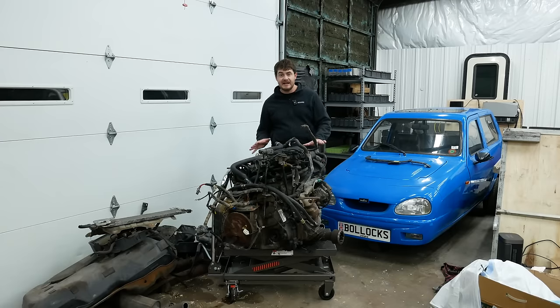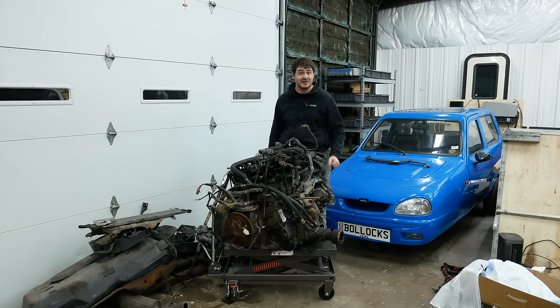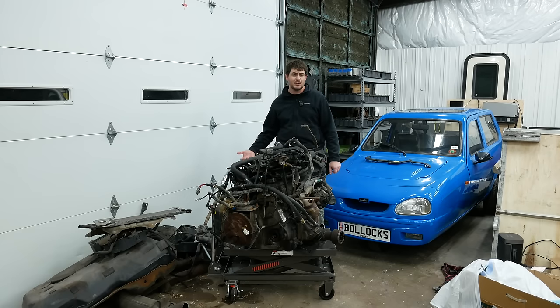I've been saying this thing has a blown head gasket, but I don't actually know that for sure. All I know for sure is it has an exhaust leak. We both know that because we both heard it. It has an oil leak, probably all over the engine. The bottom of this thing was just shimmering with oil. The alternator is absolutely caked up with oil. It has a coolant leak. The water pump was dripping. When I drained out the radiator, almost no actual coolant came out. I think I got a quart out of the whole system, but there was quite a bit of sludge in there. And when I took some of the coolant lines off, there were copper flakes floating in the coolant all over the place. I don't know how they got in there or what they're from. My first thought was rod bearings, but how would they get into the cooling system? And when I drained the oil out, there was no water in it, so that further confuses me.